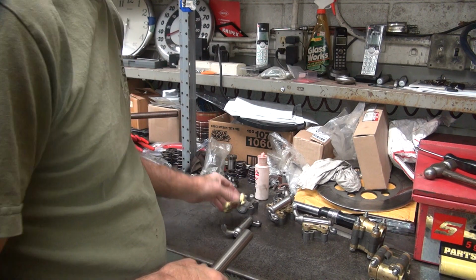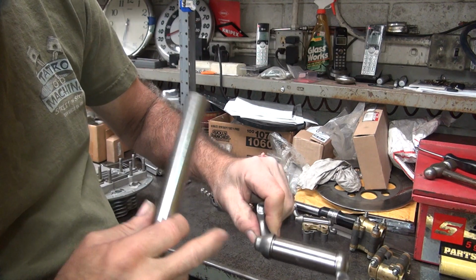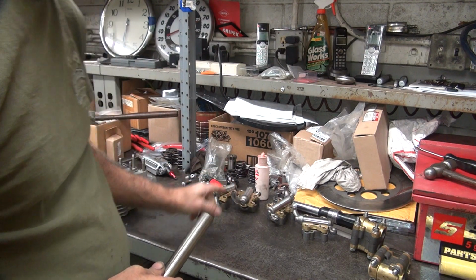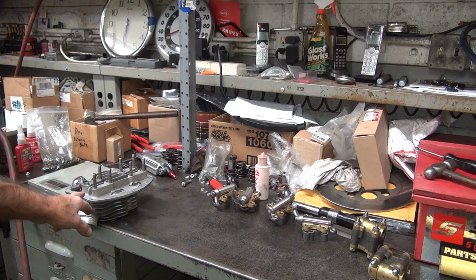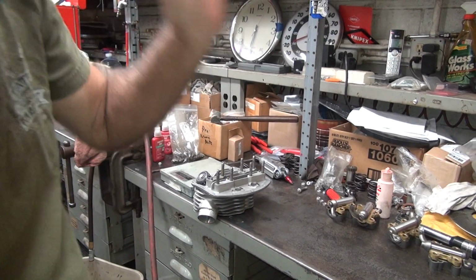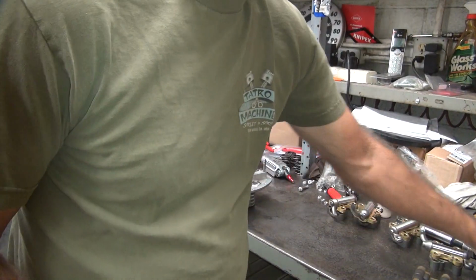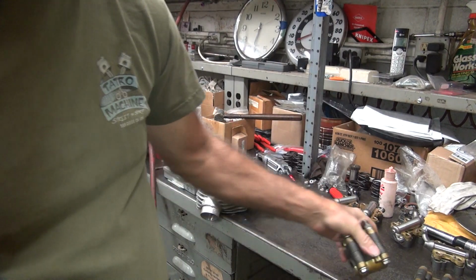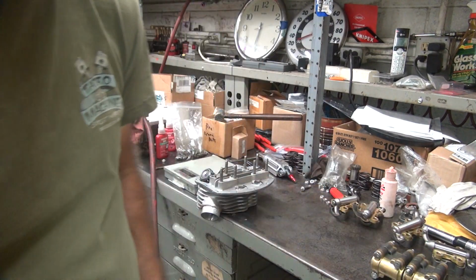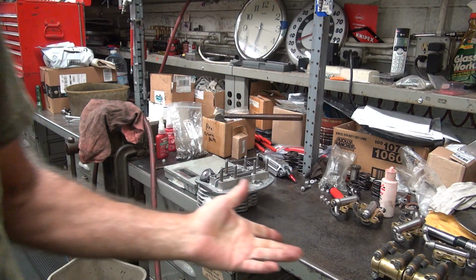Okay. So I can change out these studs, no problem. But I got to keep the arms to each rocker arm because they're fitted to each valve location on the head over here. So I can't mix those. So I'm just going to make sure these don't get mixed up. But I can go ahead and hone these to size, and then we'll be good to go. So half the work's been done on those already, so we'll do that too. Hopefully that gets rid of that grinding noise.